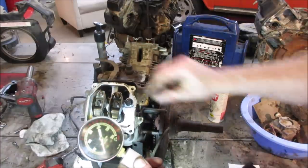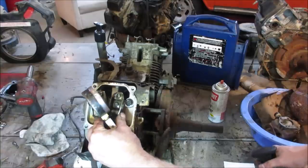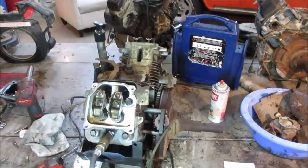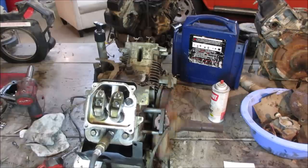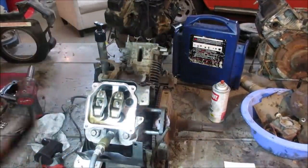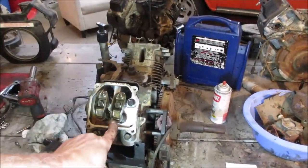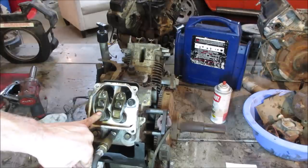Come on, baby. It's not supposed to get worse. Make sure I don't have a push rod that's not seated correctly down below. No, they're good. I gotta set up a little bit, see if it comes back. Wherever you lock these down is kind of how they're centered too. This one looks like it's on an angle, but I'm centered over the valve. Another thing too, I was kind of wondering, why has it got this weird mark right in the center of the rocker?